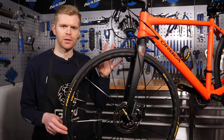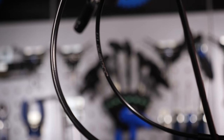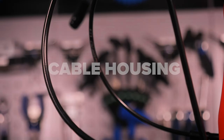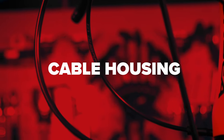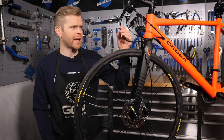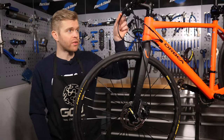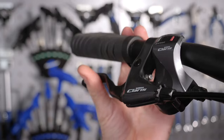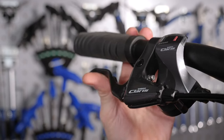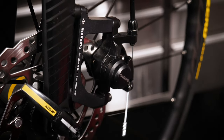To get the most out of your mechanical disc brakes, there are some components we'd recommend. First and foremost, cable housing — we'd suggest using compressionless brake cable housing. This eliminates any inline compression of the cable outer and means that all the force when you pull the lever is transmitted through the cable and into the caliper. There are several brands that make this, so just check at your local bike shop and see what they've got.